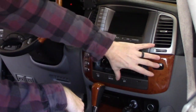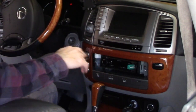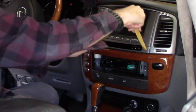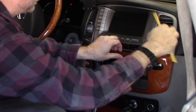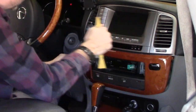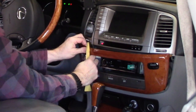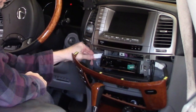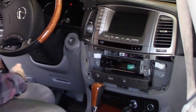So what we're going to do is pull this off. I know you see this open space here — it's only been four and a half years I haven't fixed it. I can grab it from the side here. We have a plastic removal tool. You can just push down and pull, and you will be able to eventually pop this right out. Same with this side. You've got a connector here — just push down this little tab and pull it out. Same here: push down, pull out, and we're out.